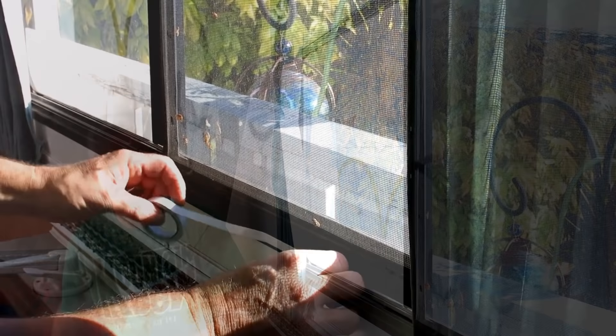There's no doubt I lose a lot of heat when it gets cold in the trailer just simply from the windows. There's only a single pane of glass between me and the outside. So what I thought I'd do is try out a window insulation kit. It's just a heavy gauge plastic and two-sided tape. There's a really good ridge all around the window of the A-liner, so I should have no problem adhering it. And the best thing is it only cost $1.25 — so what do I have to lose? Let's give it a go.